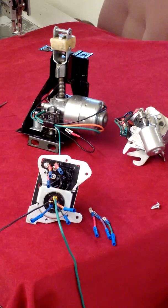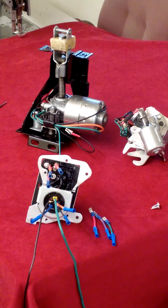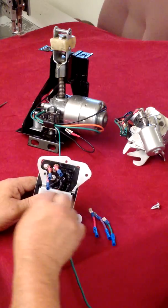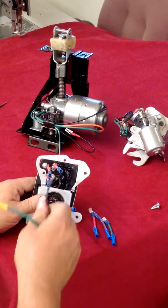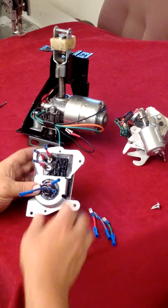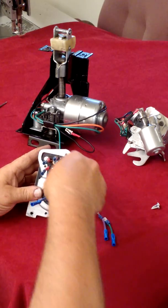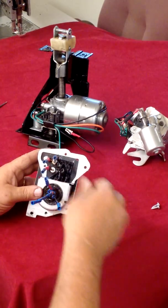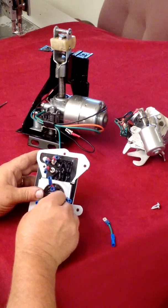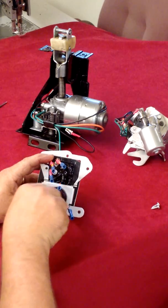Checking ohms of resistance is what we do to verify our circuitry on every component that we build. This is very low resistance. We're getting true voltage. Whatever our output is, that's what we're getting through the system. So we know we have a conductive piece here that is giving us real voltage that will be transferred to the opening and closing motor, and the end result is a system that functions the way it's supposed to.